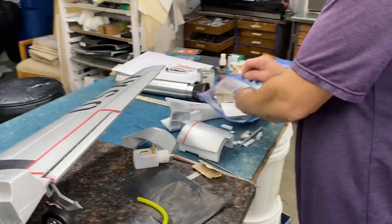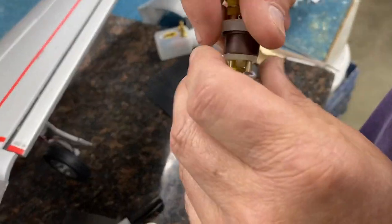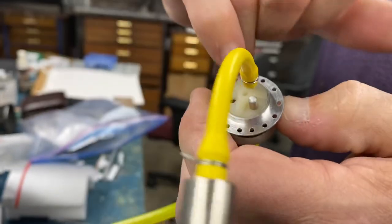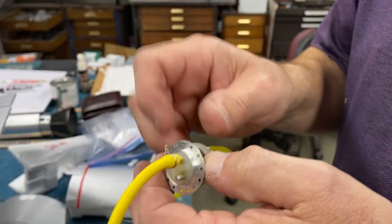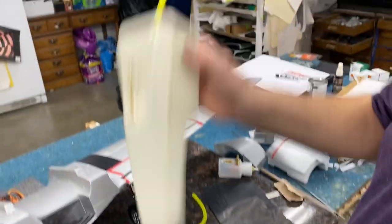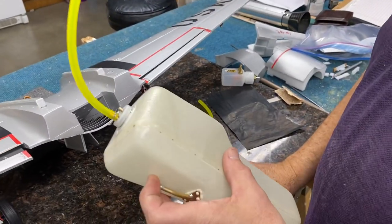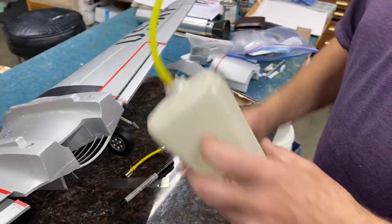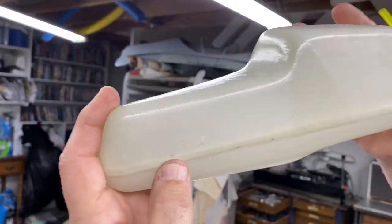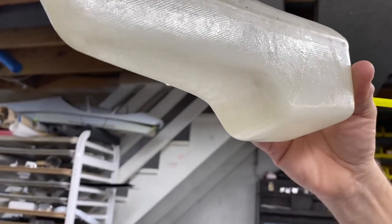It is a little tight in the fittings, but a single drop of turbine oil down through here and it will just slide right on and create a really good seal. When you tighten up the screw, the stopper will kind of conform around the outside and it works fine. Once you're done with a setup like this, immerse it in a bucket of water, put your finger over the vent, blow through here, and just leak check everything before you permanently mount it inside the model. The clunk rattles all over and I haven't had any troubles — it works out really great. It's like a sump down in here and you can pretty much use every last drop of fuel.